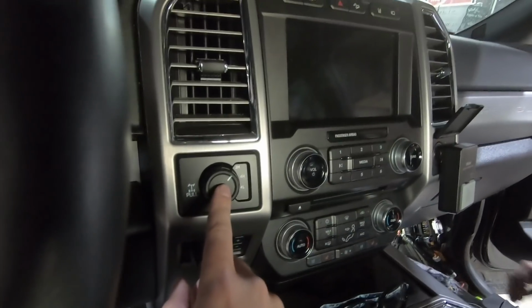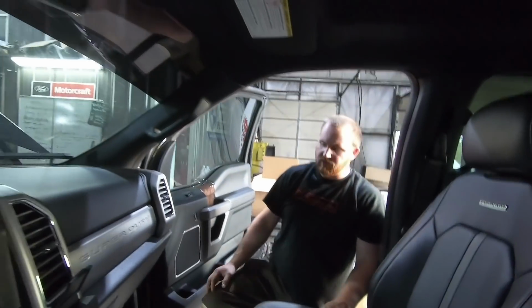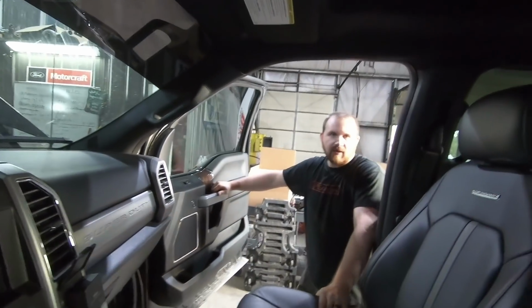But whenever you pull that, it disengages as soon as you hit 20 mile an hour. Why do they do that? I think it's a safety precaution to disengage the differential, and wear. I mean, I think longevity. So on the actual locker itself, if you're trying to do a big smoke show burnout, spin both wheels, you can't. You'll spin them up to 20 mile an hour, and then it will just go to traction control, and the whole BS where both of them aren't spinning.